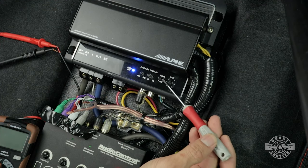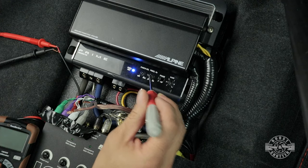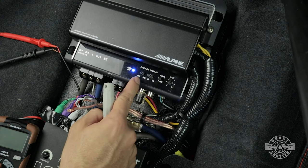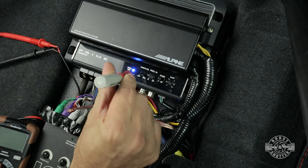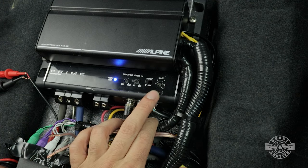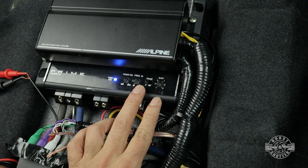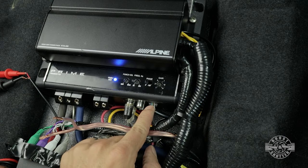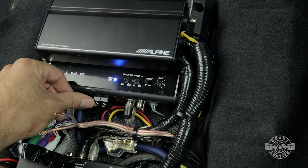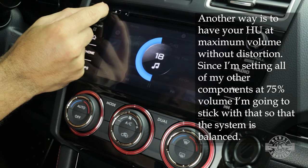The first step is turning the gain all the way down to as low as it goes. I'll keep the phase at zero. The low-pass filter frequency — you can put that somewhere in the middle. The punch equalizer adds fake bass to the system and just doesn't sound right, so make sure that's turned all the way off. If you have a remote punch level — this is just a remote gain adjustment — whatever you set your maximum gain to, the maximum level on the knob denotes that. You can either unplug it or go to the remote punch knob and set it to maximum so the reading you get is accurate.